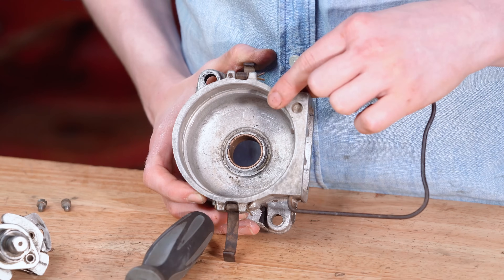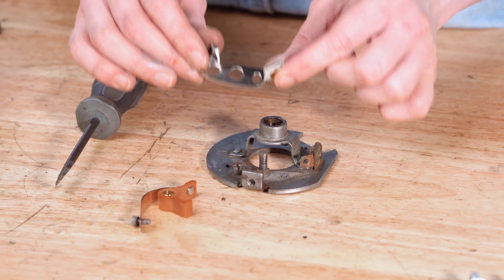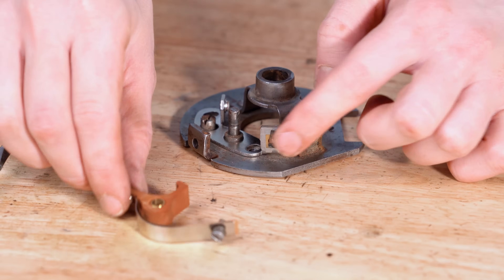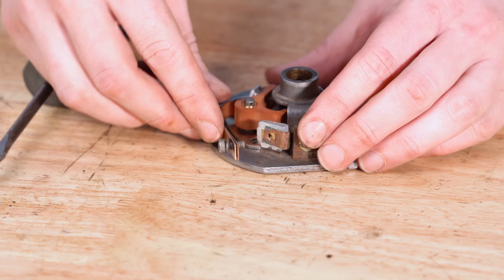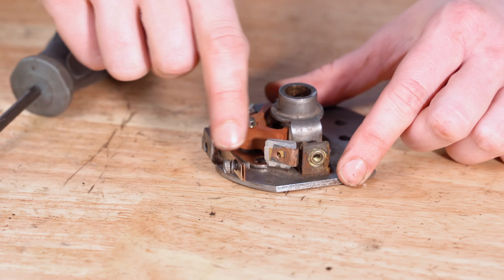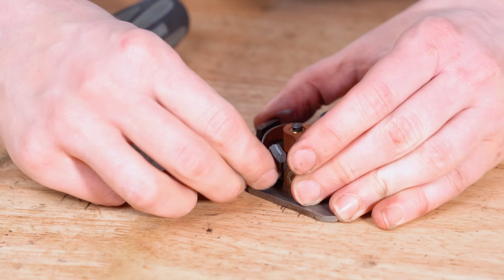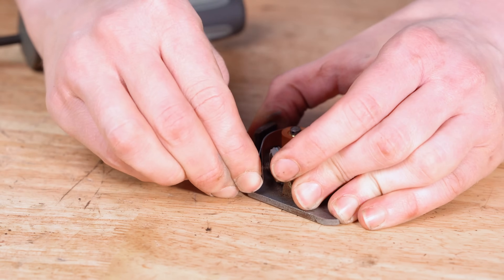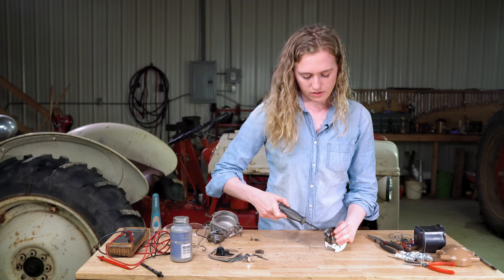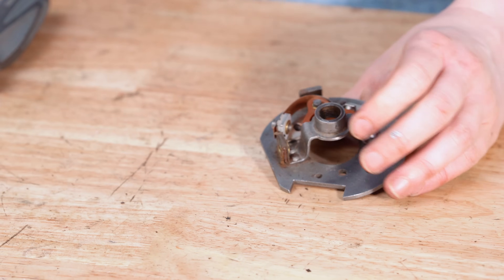I was able to get the case of my distributor very clean as well as the plate — I used a wire brush on it to make sure it's clean and ready to be reused. I am now ready to put my points into place. I have found that it's a lot easier to put your points in when the plate is off of the distributor. The screw on the edge can be really tricky if you try to put it in when it's in the distributor. Your points come around here and your screw goes through both parts of your points — this tab as well as into here. If this tab is broken off, you would want to purchase a new plate as that tab is really essential. I'm going to chase this around here, line it up, and once it's lined up, I'm going to tighten the screw in there. Once that screw is tightened, we'll be ready to go back and talk about the case.